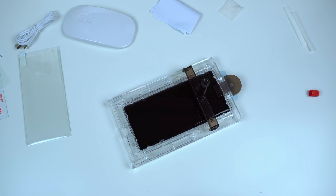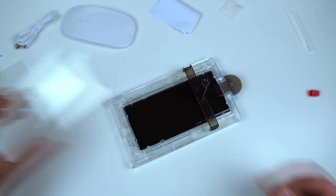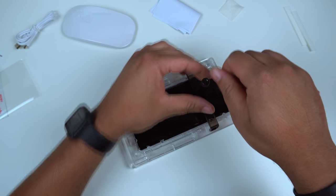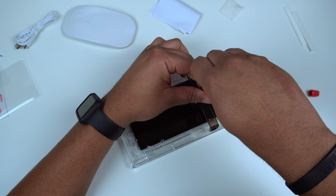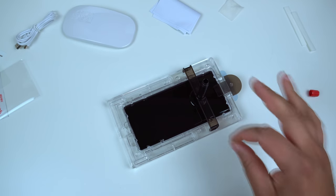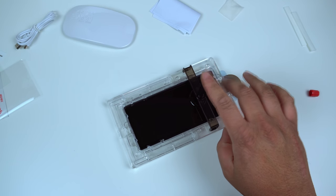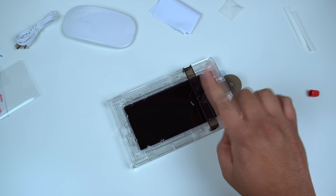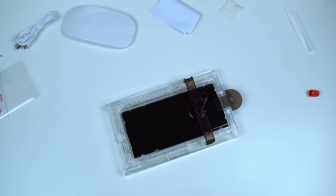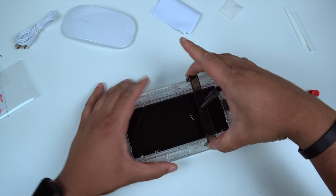I think we are good to go. Let's take the screen protector out — we're not quite ready for it yet, but let's get it to the side. Next, unscrew this valve, which releases all of the glue down — you can see all the glue is right there. Let it sit for a few seconds. I give it a little tap to make sure all the glue is out, then go ahead and carefully remove the glue container in case any excess drips.